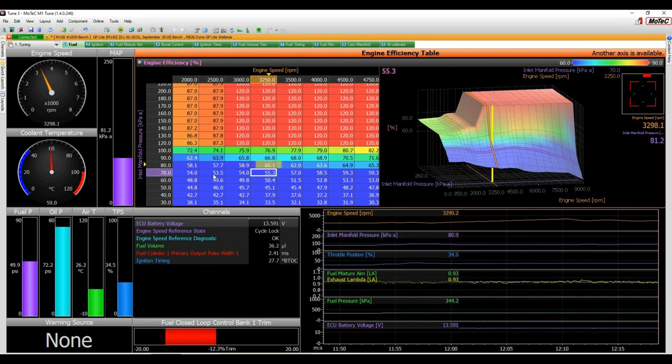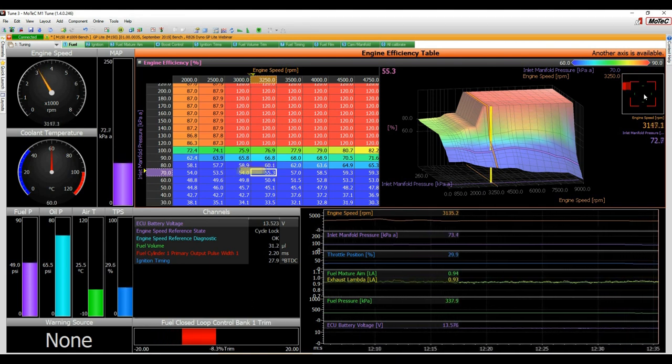So, you can see if I look at the box for start, it's red and it's telling you you're not in the right place, and this dot is above the target, so that means I need to close the throttle. So if we're closing the throttle, you see it come down and the dyno will back the brake off. Just right on the edge there. Oh, the control is awful.